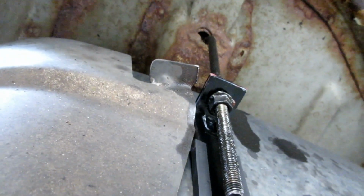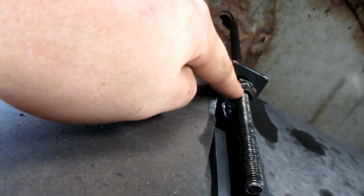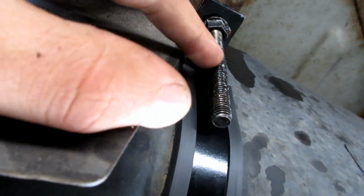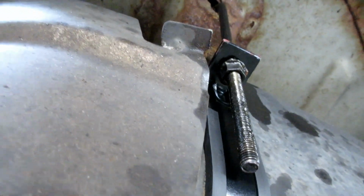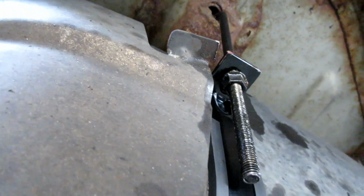That's definitely not the right way. If you were to do this the right way, you'd want to spend some more time to get this nut out while it's on the Jeep still, and you'd be able to just slip this on this shaft here like you're supposed to, and you'd be done right now. But I'm going to take another couple minutes, drill a hole there, then find some kind of piece of wire to wrap around there. But it's on there.